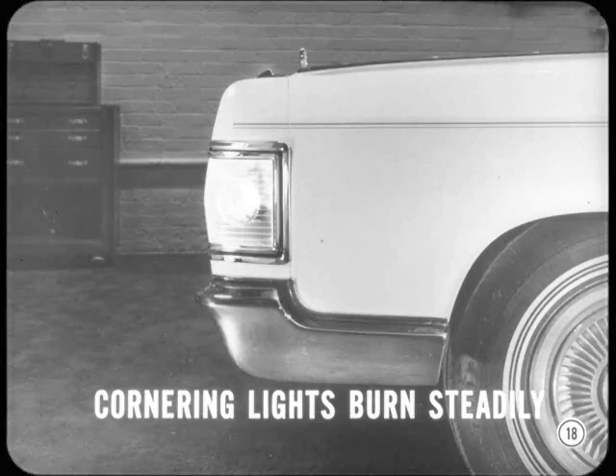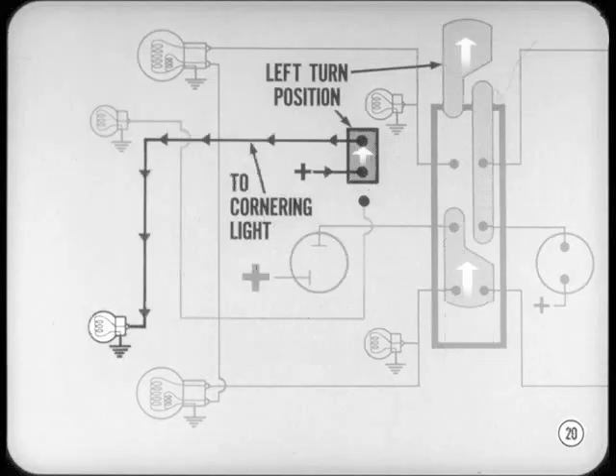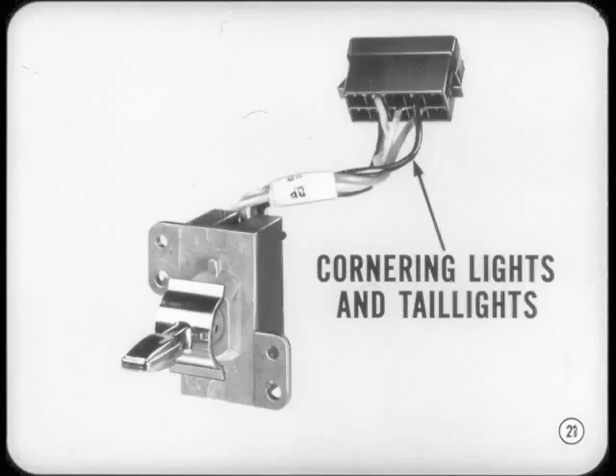I've noticed that on cars with cornering lights, the lights burn steady even though the turn signals blink. How does that happen? Well, that requires a different turn signal switch, Danny. There's an extra set of contacts in this combination turn signal and cornering light switch. A separate hot lead feeds the center contact in the cornering light switch, and this hot lead doesn't go through the flasher unit. When the turn signal lever is moved to signal a turn, the cornering light contacts move with the turn signal contacts, completing the circuit to the cornering light — and since there's no flasher in the circuit, the light glows steadily. The feed for the cornering lights is also the feed for the tail lights, so the cornering lights operate only when the headlights or parking lights are turned on.